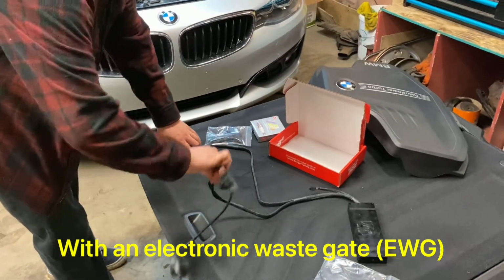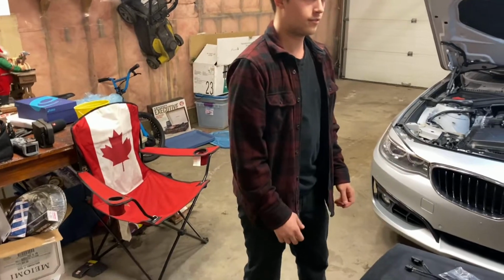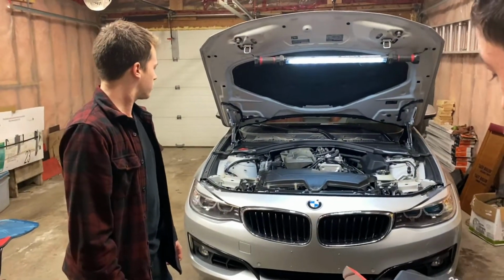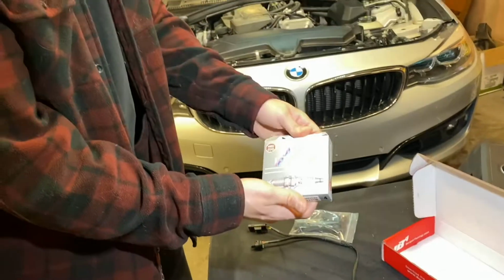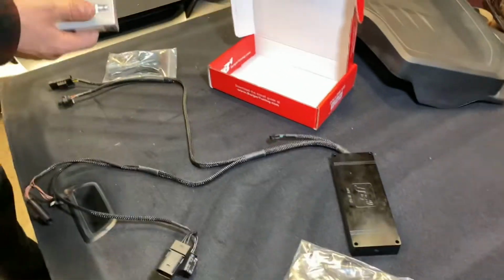We're going to take you guys through that process, and you're going to get a video of our reaction. We'll tell you what we think and see how it goes. If we run into any problems, we're going to be throwing some spark plugs in there. I believe they're one heat range colder? Yeah, one heat range colder. And we're expecting about 50 horsepower out of this JB4 unit.